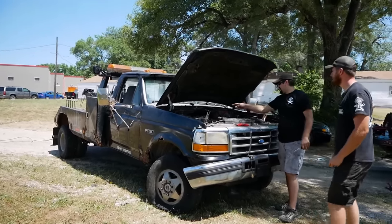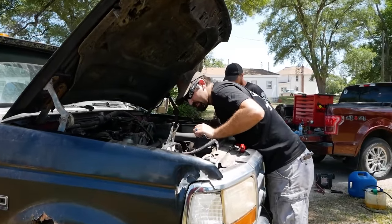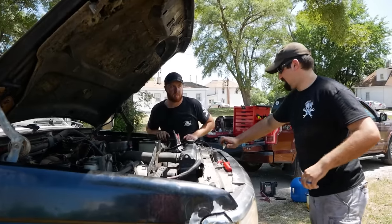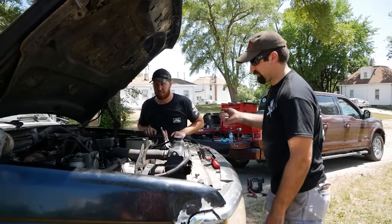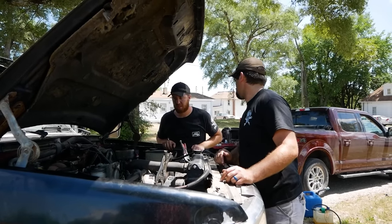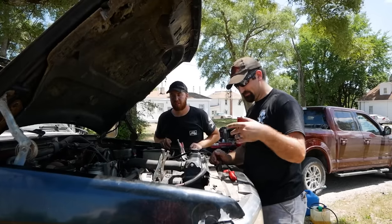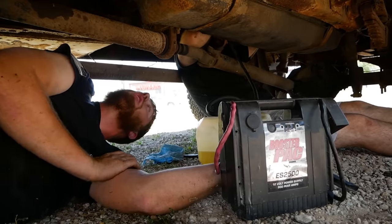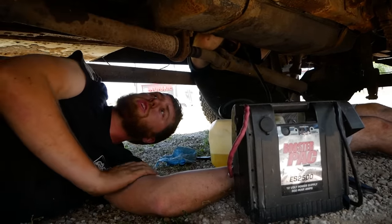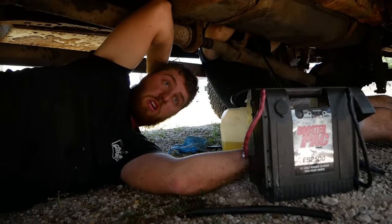Okay, but maybe not. I am not getting any more fuel. I bet those lines are junk. I'm betting they're either plugged full of crud, or we've got an air leak somewhere. It's sucking air. I figured I would stop it now. So there's still some fuel up here. Yeah. So our fuel lines for this tank were completely obliterated and pretty much gone, and we're getting air in the system and it wasn't trying to run off of it.